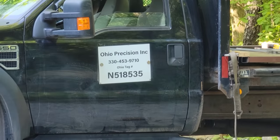But every time I try to pinpoint or diagnose it by messing with wires and stuff on the trailer, it won't do it. It doesn't happen whenever you want it to. Exactly. It only does it really when I'm driving. So I'm assuming there's a wire on the trailer somewhere that's just completely loose. I tried having TQ sit in the truck, like right now, we're back to working. Everything's working good.